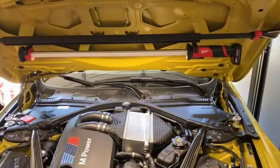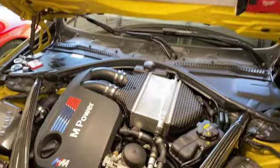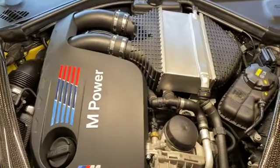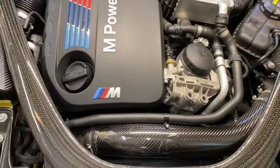All right, we just got back. This is the first time using my Milwaukee underhood light, and it's pretty awesome so far. Things are still warm, fans are still going on, so we'll step you through what we're going to do next. This product, which by the way I bought on Amazon, I'll put a link down below, but you can get this stuff pretty much anywhere. It says to inject it downstream of the mass airflow sensor because this chemical will damage that. And you want to get the stuff as close to the throttle body as possible. Just about any vacuum connection on the intake path would work.